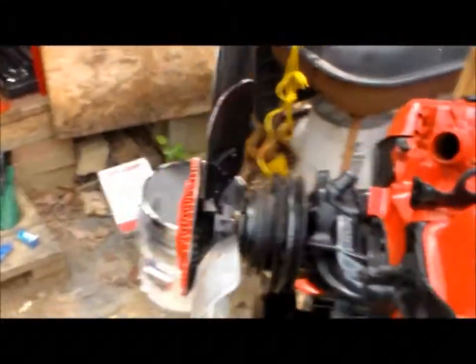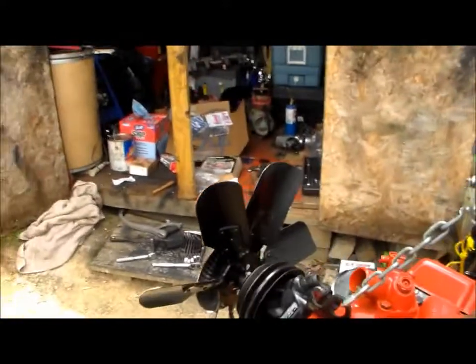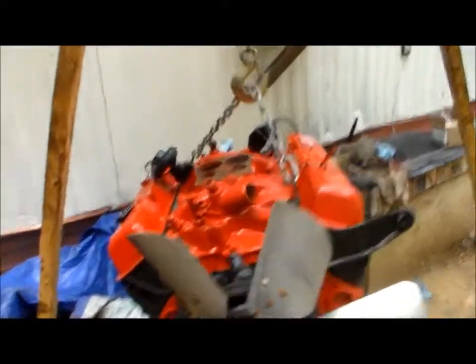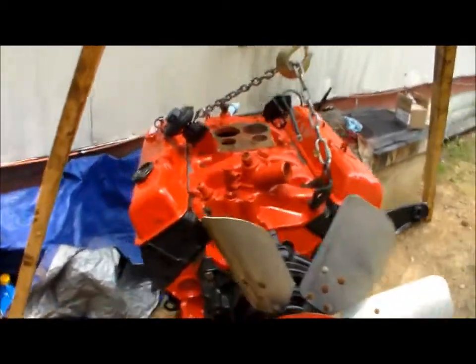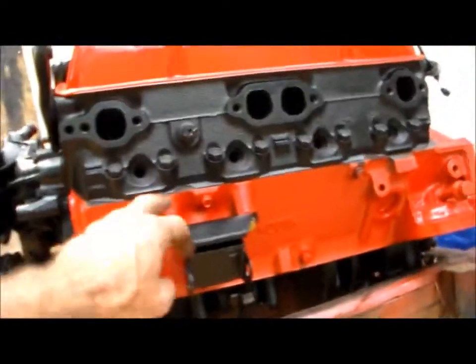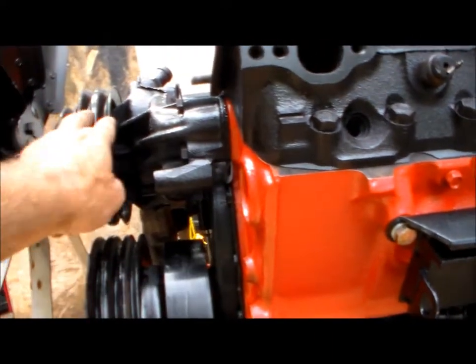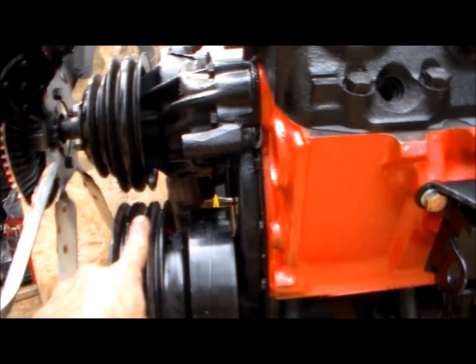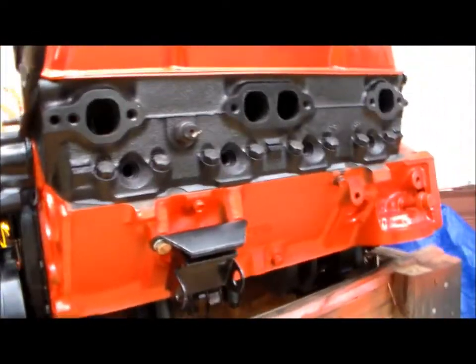Okay, I'm back and I just put a few more parts on — take a gander here. That looks good. Now if you notice, I got the back side black but the front side like that — pretty cool, huh. I just put the new motor mounts on, they look good. I got the harmonic balancer on, the bottom pulley on, the water pump on, and the pulleys on. All I really need now is the power steering pump and the alternator, and it should be ready to fire as soon as I get my headers in.